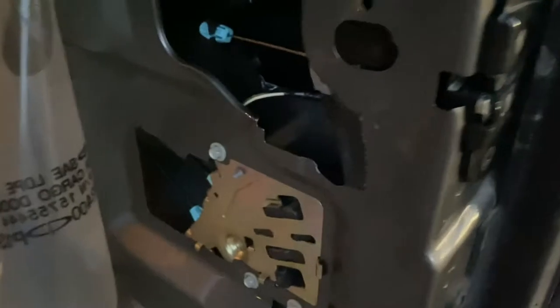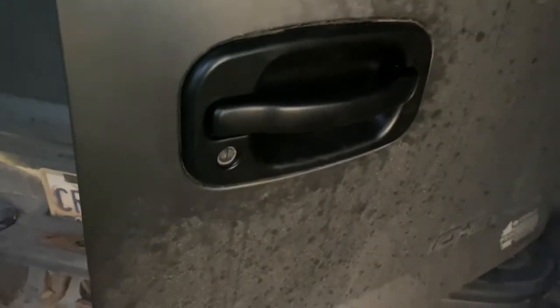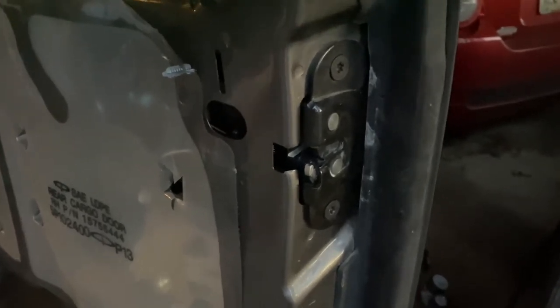With the locking mechanism, it's still somewhat sticky so I'll just slide it back in there and make sure it goes where it needs to go. I did just take this whole thing back apart because the power lock wasn't working, then gave up and put it back together. I learned that the door needs to be shut for the power door lock to work — you can't just push these in by hand. It must have something to do with these contacts and some kind of electrical thing. When I shut it and used the power locks, it all works.